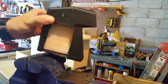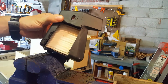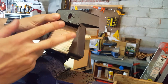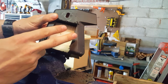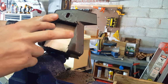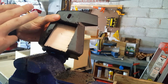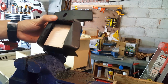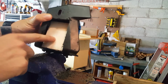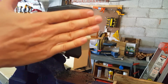Sweet. I'll do another video real quick about all the problems I'm finding in the go-kart, but the carb shot doesn't seal properly. The gasket or the head for the exhaust is cracked, and the bolt holes where you bolt the exhaust on, one of them's half gone, and I just blew a bearing on one of the front wheels. So I'm gonna get a new engine, but in the meantime, free up the old one as much as I can. See the next video.